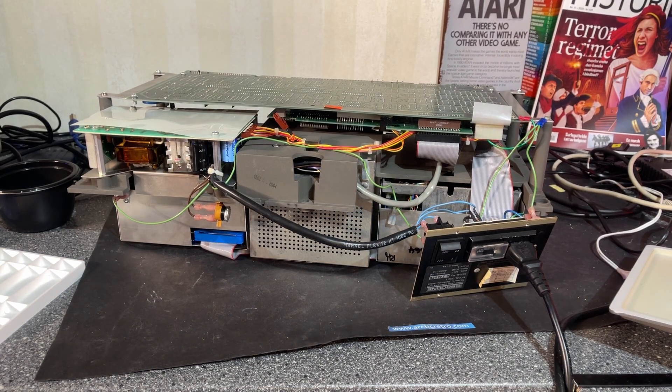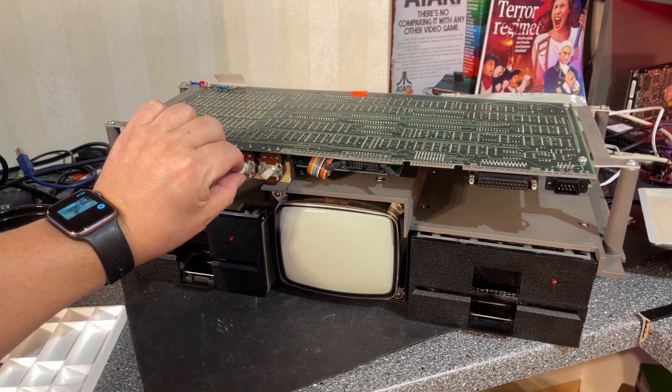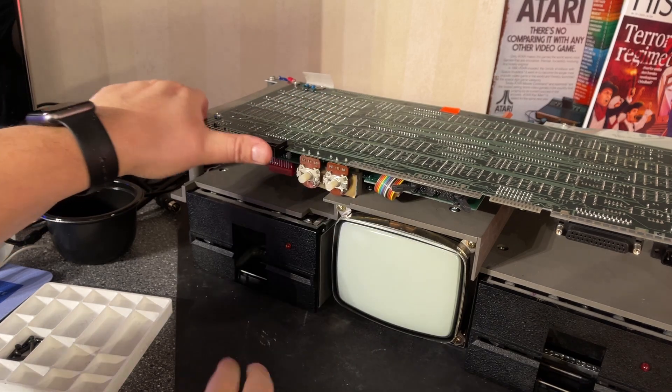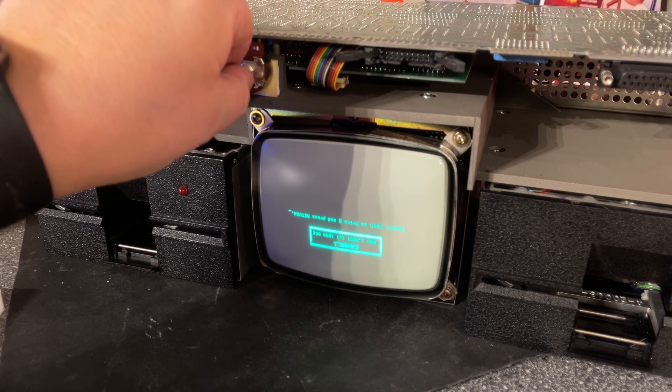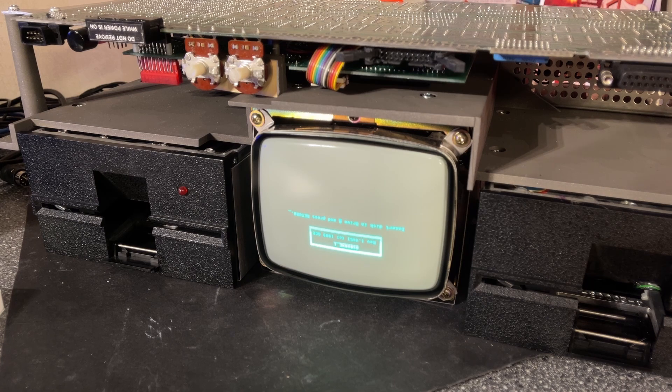I heard a beep and nothing blew up, so I guess it worked! I'm going to turn the machine around and see if the screen actually came on — it is upside down, so let's see if we get anything. Yes — you need this terminator or otherwise it will use external video. Sure enough, it actually says 'insert disc in drive A and press return' — upside down! The machine is still working. I put everything back in the correct order and I'm happy about that, so now I'm going to insert it into its newly cleaned case.